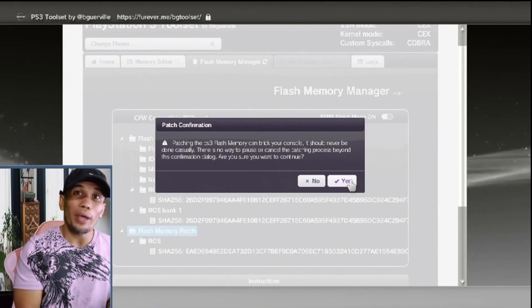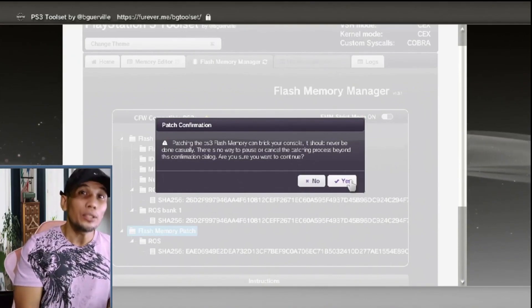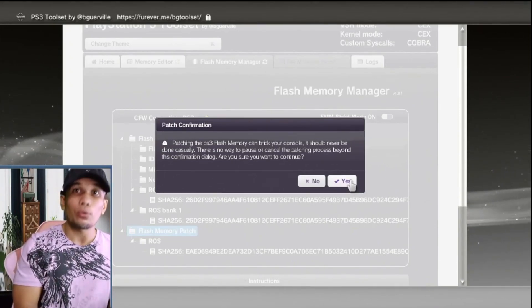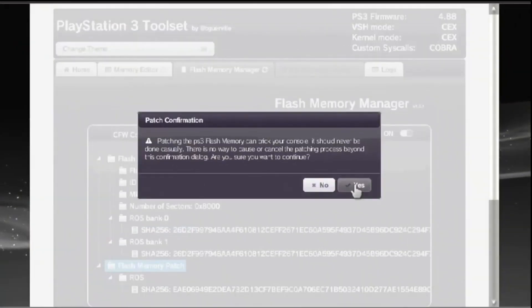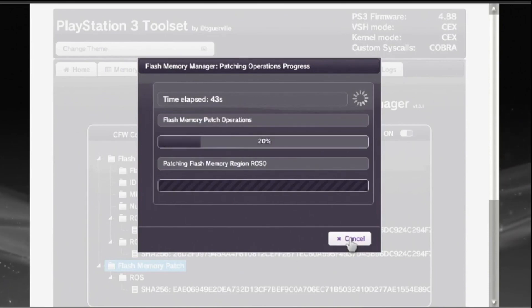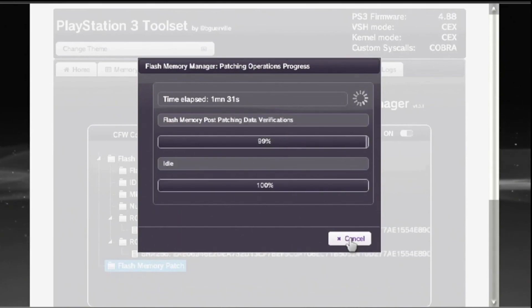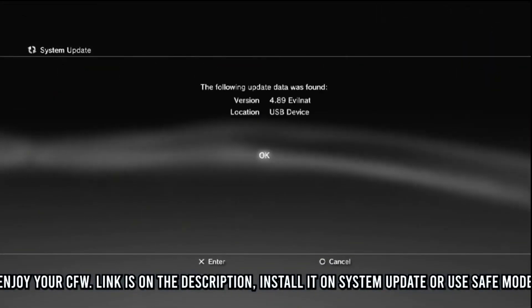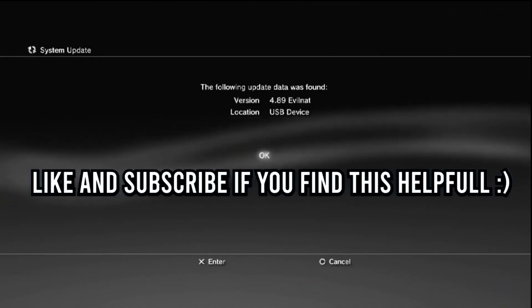It is highly advisable to do any updates using Safe Mode. If you encounter any issues before you get to this part, start the process from the beginning to avoid possible issues. Also, remember to have a backup of your original dump file. After the patch, restart your PS3 and install the CFW. One important note: after you install the CFW and want to update to a later version, you don't have to go through the whole process — just directly install the new CFW on top. For example, if you have 4.89 CFW and want 4.90, just download and update on top of 4.89. In case you encounter any issues or errors, share them in the comment section and I will address them. This is Ali — if you found this video helpful, please like and subscribe. See you in the next video, bye-bye.